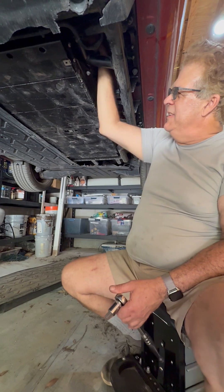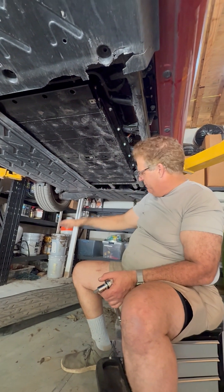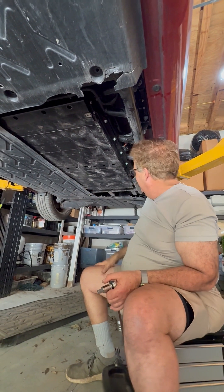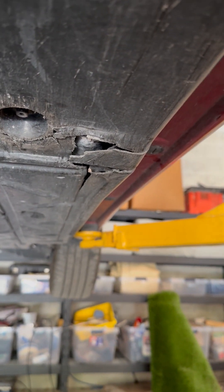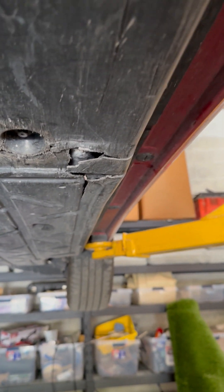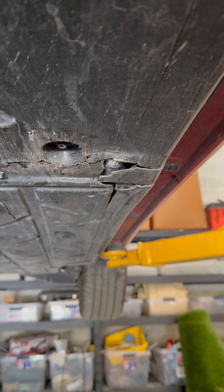When you're doing this, look at the battery — this panel comes off with a few screws and that's what covers it up. If that panel is damaged, or if there's new damage on that panel, pay real close attention. There's no damage here, so nothing penetrated, and I know the battery underneath is good. I wanted to give you an example of what you're looking for — if you come down here and see damage like this in the battery area, that's what you've got to be concerned about. I'm familiar with this car and I have pictures from last time, so I know that damage was there before. But if you're underneath the car and notice something for the first time, look very closely — you don't want damage to your battery.